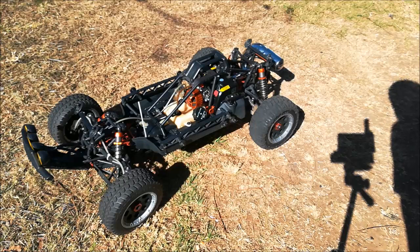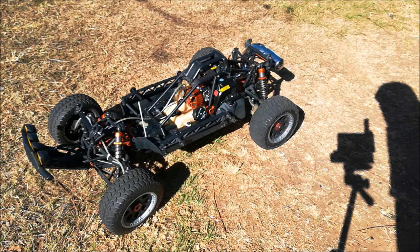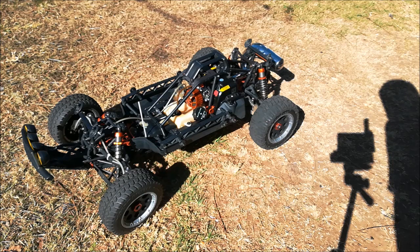Thanks for watching, guys. There it is, all back together — nice and pretty with a pro pipe. We're going to start it up and let it idle for a bit, running some heat cycles through it: run the engine hot, cold, hot, cold to make everything seat nicely before we take it out to drive it or before the customer takes it out. It starts pretty easy now.